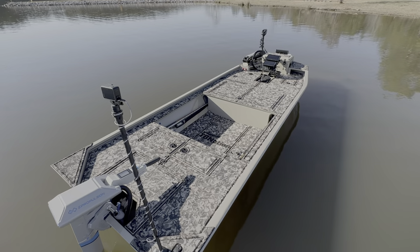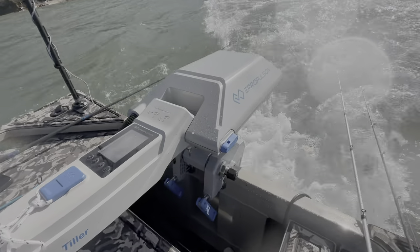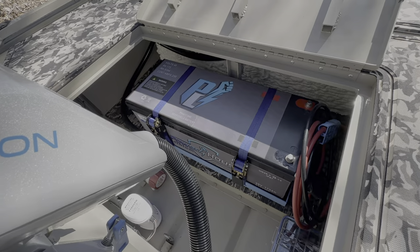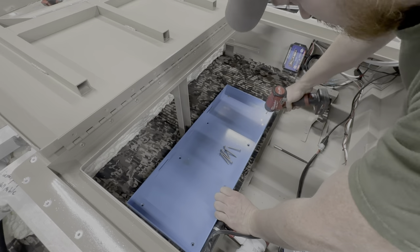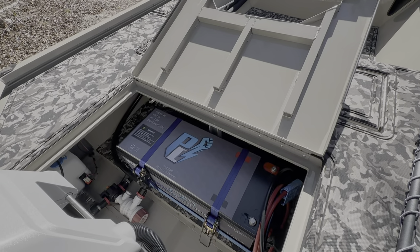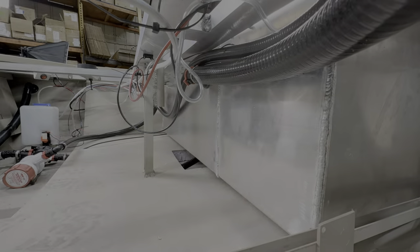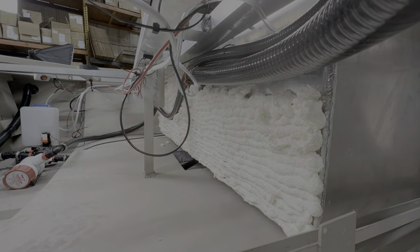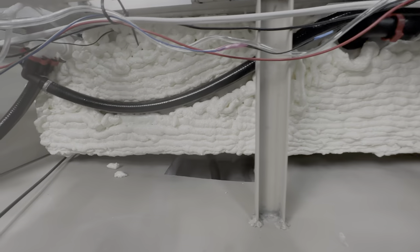There's another seat base with the AMP Marine cap in the rear. The motor is the brand new E-Propulsion Navy 6.0 — the lower end is a bit smaller, they shaved about 40 pounds off and went with a new prop. Powering it is one single Powerhouse 48-volt 173 amp-hour battery — an absolute beast. Chris worked with Powerhouse directly to get this battery specifically designed for electric outboards. The live well tank got quad-foamed to insulate it, since aluminum tanks tend to get very hot.